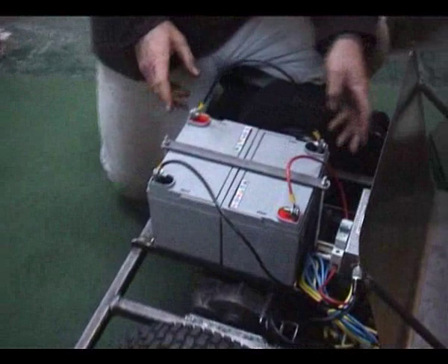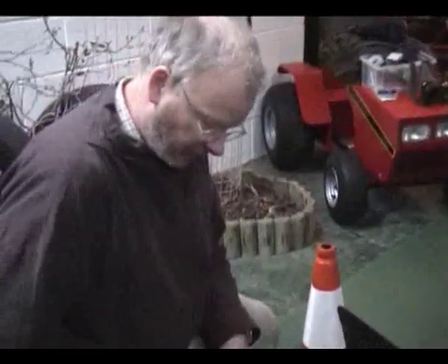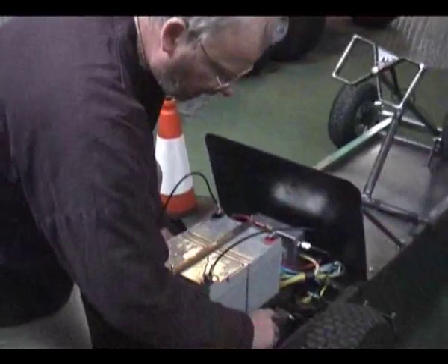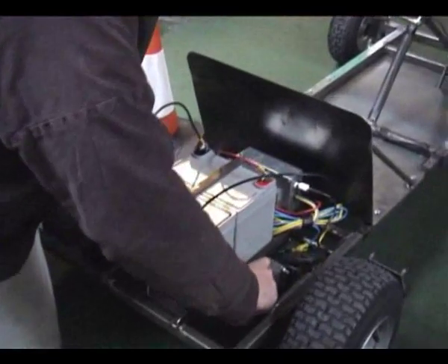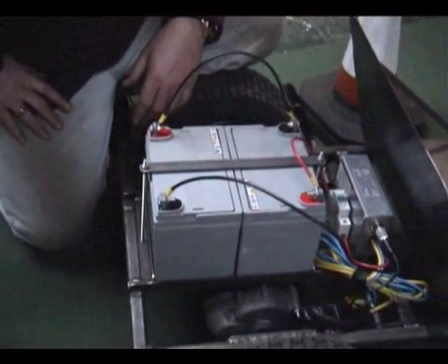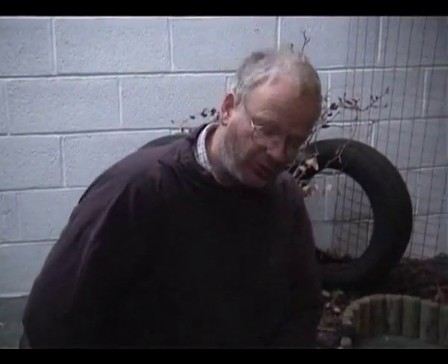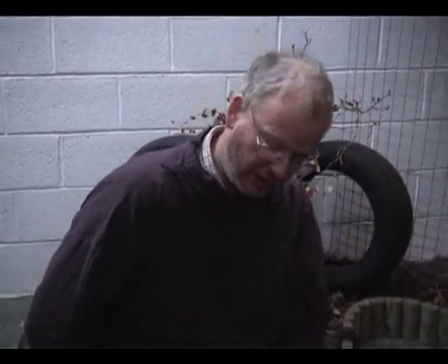This is a Wasp electric cart. It's powered by two 12 volt batteries put in series, which means the positive and negative are joined up in a loop to create a 24 volt battery. This powers two 12 volt, 150 watt DC PM — permanent magnet — motors. So in essence 300 watts of power, which is plenty to get this cart moving quite rapidly off a start, reaching a terminal speed of 6 miles per hour with the gearing it's been given.